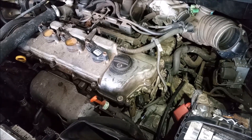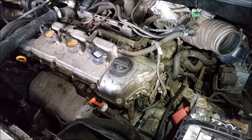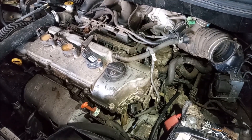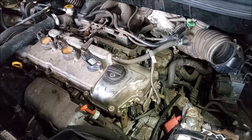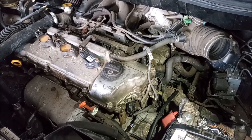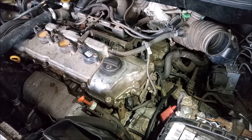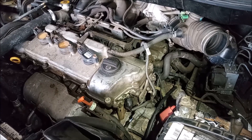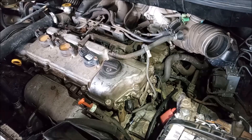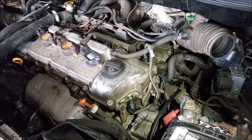I don't know what the intention was with using a plastic thermostat housing. This is a design flaw that afflicts a lot of vehicles, in particular Fords and Mazdas with Ecoboost or whatever tech engine they have. They all have thermostat housings that just crumble and have to be replaced. We would have thought Toyota would not fall into this same trap — whether it's cost savings or weight reduction, we don't know. Whatever it is, it's a bad idea.